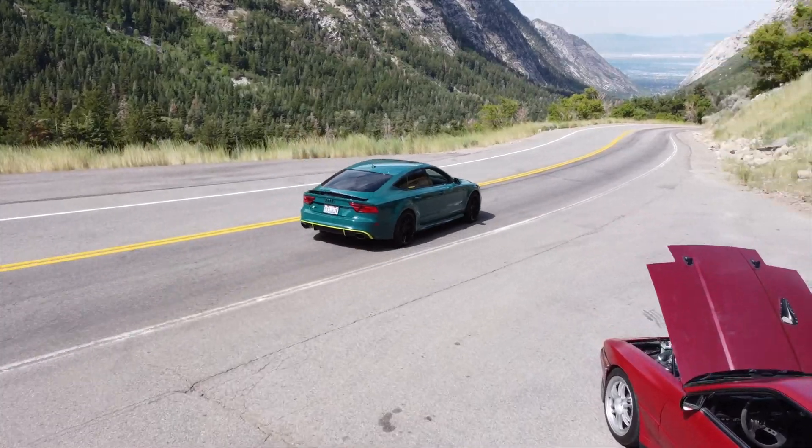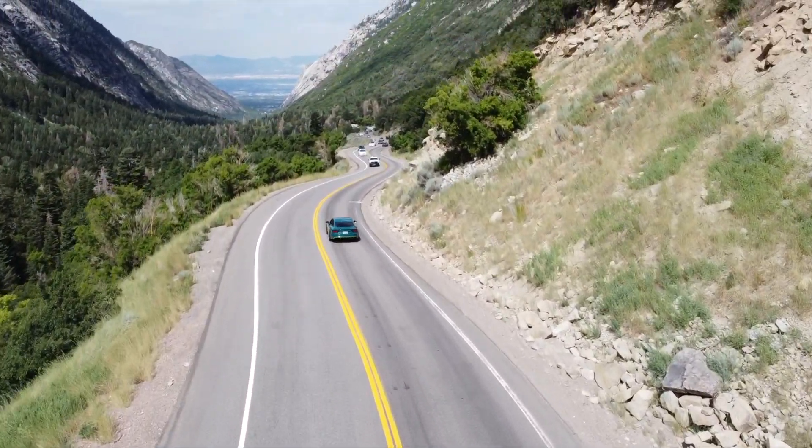Because of the canyon, I don't know exactly what the elevation change rate is, but it's pretty high — we have a ton of ski resorts up in that area. This little area is just before one of the major ski resorts here in Utah. Because of the elevation change, cars in general tend to run pretty hot. So what I've done is put an electric radiator fan on the front acting as a pusher, and then the clutch fan that comes factory in the car is acting as a puller. That way I don't have any air cavitating in that area between the intercooler and the radiator.